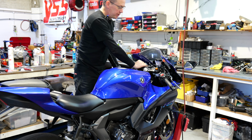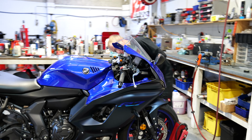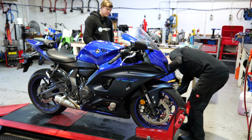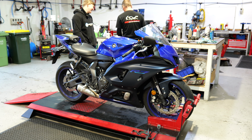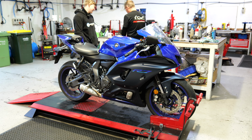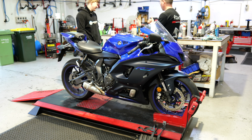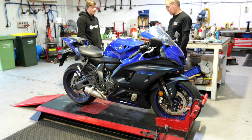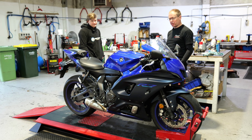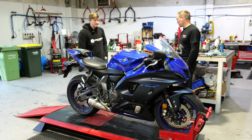And straight away it feels better. Right, so I'm just going to take that second measurement again. Okay, 120. Now we're cooking. You see straight away. 15 mils just by doing. So we're at 120 now, 10 mil, perfect static. So the rear shock is actually static-wise, without you sitting on the bike, is perfect. And that, I just kind of ballparked it. I've actually come out spot on.